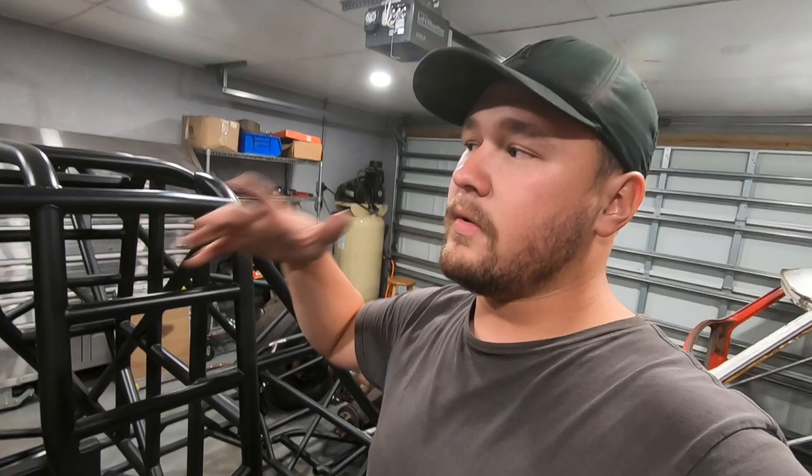So today we're going to be setting up another paint booth and re-spraying the whole chassis. We're also going to be spraying the rear axle and the inside of the cab. For this go-around, we're actually going to be using some Eastwood single-stage urethane paint. I've used their single-stage paint before and I really liked it. If you guys remember the old black-ish Civic on the channel, that's what I used to paint that car and it turned out really good. It's really hard to beat, especially for the price. Hopefully it holds up a little bit better than this primer is. The good news is this primer is going to work really good as a primer for the new paint, so all I've got to do is do a quick sand on this whole chassis with some 320 grit and then spray right over it.